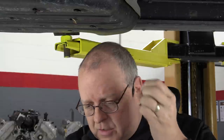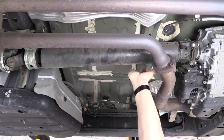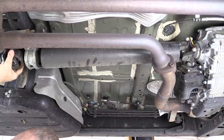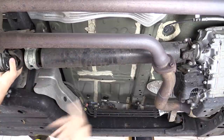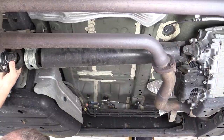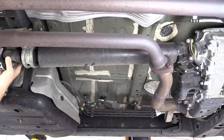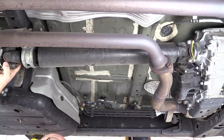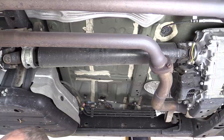First, let's look at the tubing of the drive shaft itself, starting with the front drive shaft. We've got steel tubing here — we should look at this tubing to make sure there are no dents, it's not bent, and there are no cracks. Look at any welds on either end; we don't want any cracks in the welds. These drive shafts have welded-on balance weights, and we want to make sure those are there and haven't come off, as a missing balance weight could cause a vibration.